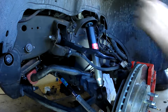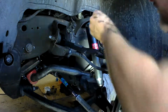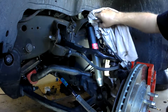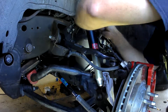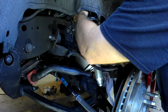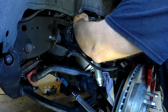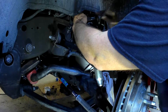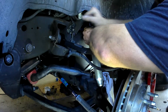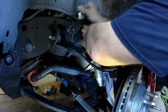There's a nut — it is a tapered lock nut so make sure you put it on the corresponding side. Once it starts to twist a little bit, just hold here. There is a hex head on the top so you could actually put a wrench or vice grips on the top, but this seems a little bit easier with this particular spacing.